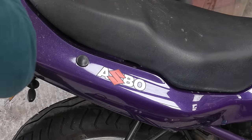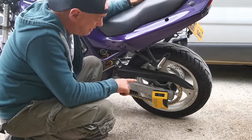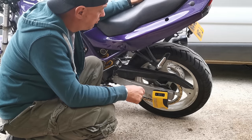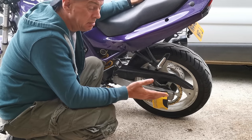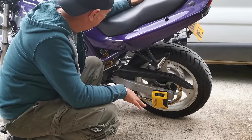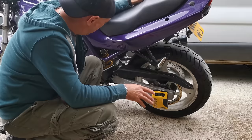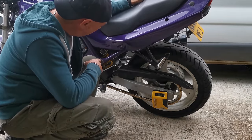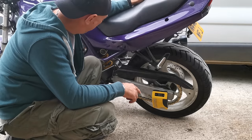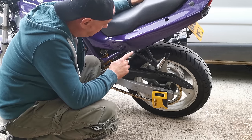Right, so we set the sag up. I've got 43mm of laden sag in the back. So that's me in all my bike gear, sitting on it, normal riding position. It's basically 43mm, which equates to about a third of the total shock travel, which is what you want for road. That's a starting point anyway. As far as the adjuster goes, preload I'm set on 3. Still got to sort out the damping. But for now, I just want to see what the ride height is doing.